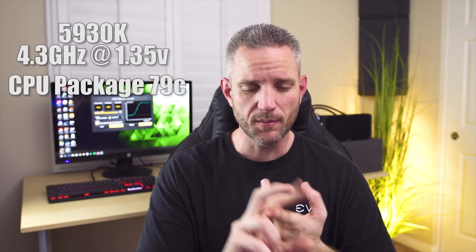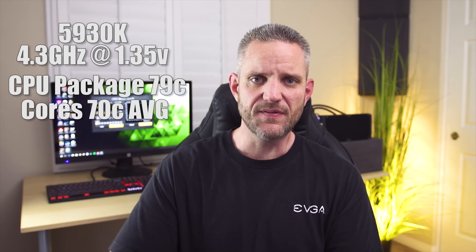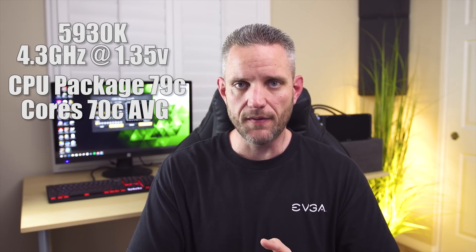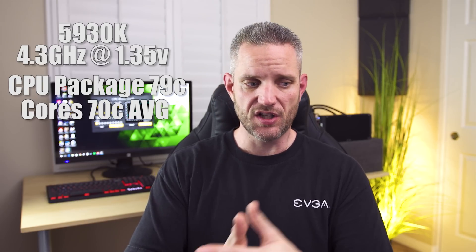So that's a lot of talking and glamour shots - what about performance? I've been stress testing all day after getting around some temperature reading bugs, which turned out to be a problem with Hardware Monitor. Using AIDA64 to monitor temperatures on the stress test - stressing CPU, FPU, and cache - which is literally a torture test pumping as much heat as possible into the system. I put 1.35 volts on here just to see what would happen. We saw a package temp of 79°C and core temps ranging from 65 to about 75°C. That's a lot - and so is 1.35 volts. TJ Max, by the way, is the maximum temperature allowed on a CPU before throttling starts to happen, and we were still below that.